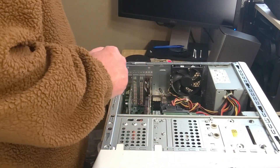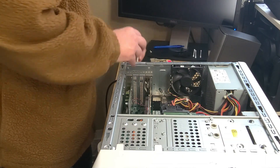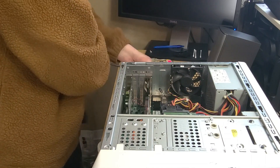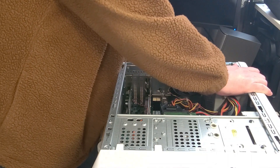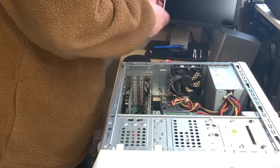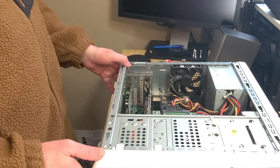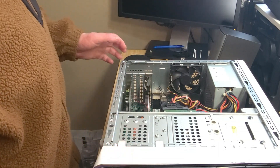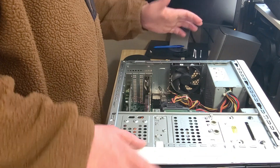They said it had Linux on it, so I'll plug the monitor in via VGA to DVI adapter into the DVI port, plug in the power cord - there's no switch on the power supply - and get a keyboard and mouse hooked in. We're getting an LED indicator on the board and there are no case open sensors, so we should be good to go.